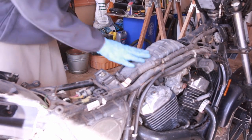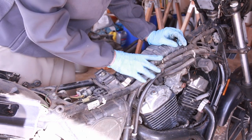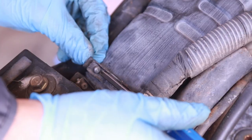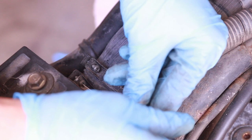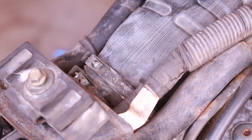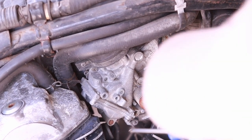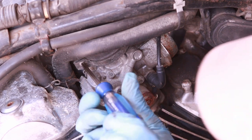This is very similar to the Honda Shadow but I love how narrow this is. So this is the air box right here and it goes into the carburetors. We are going to be pulling this out. Take a Phillips head and just unscrew that — you don't have to remove it entirely and there are two. One tightens up the air box and one tightens it higher. Now to remove this we're going to have to follow it to the actual carb. This is the carb right here. Very easy to access.